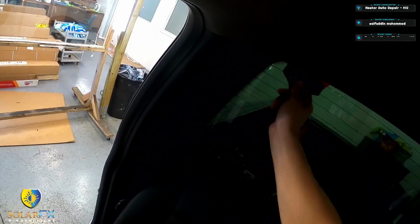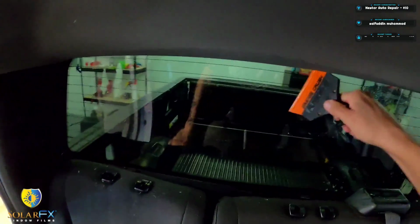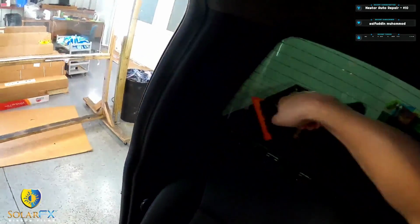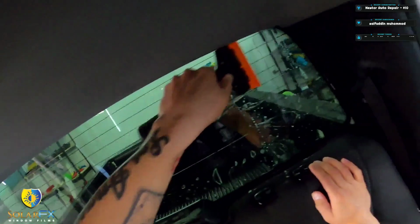If you install it like you normally would after you shrink, like a U, then you are going to get fingers at the bottom. So be aware of that. And it looks like I'm messing up because there are still fingers popping up, but that's all right. We're going to go ahead and shrink that from the inside.